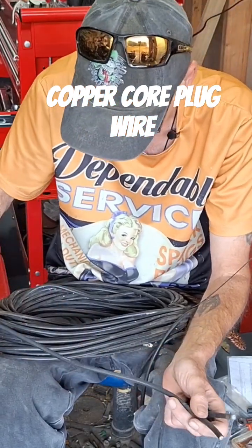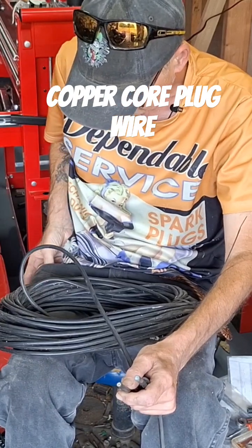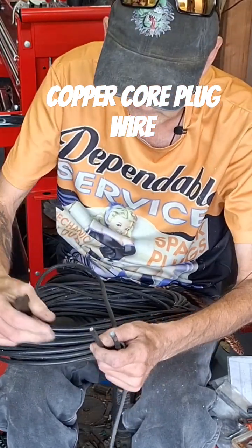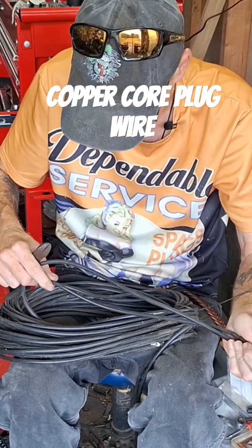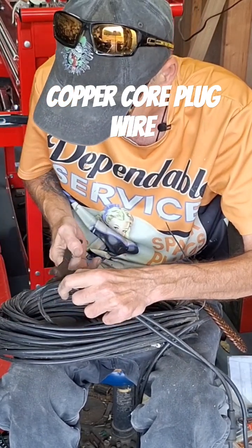This is something worth checking. You might want to pull the plug wire ends off, give them a little sanding with some crocus cloth or scotch brite just to clean them off, then put a little dielectric grease on there before putting them back.